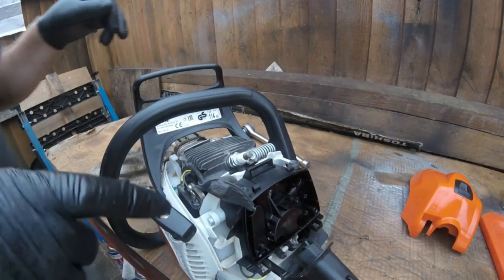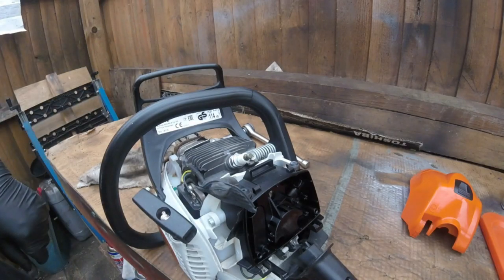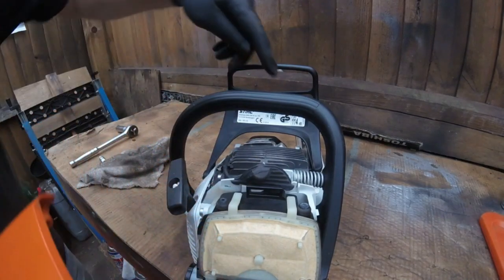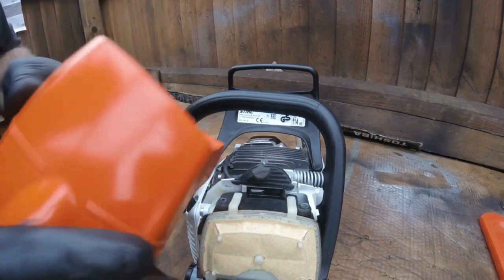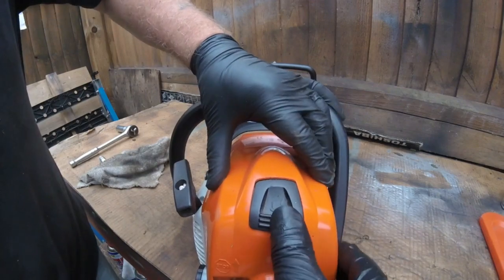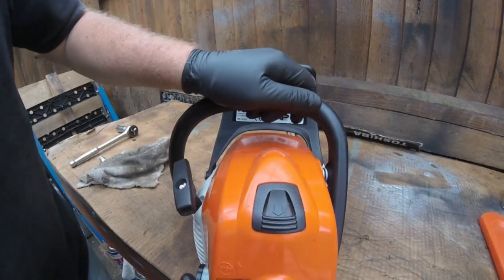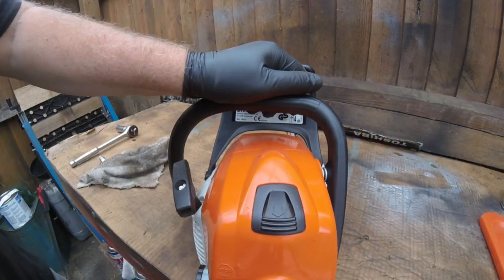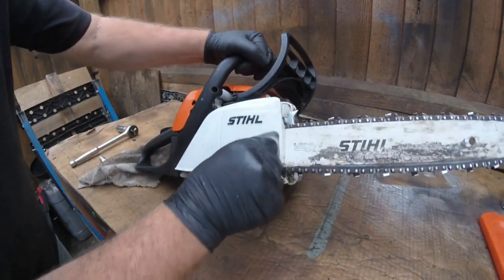So we're tying that up, put that back together, and then cleaning round by the chain area. That's all bolted in, the air filter's back on. Now to put these covers on - just inside there you've got two little lugs, they just slide onto there. Push in and then push that in - just give it a little testing because as you noticed outside it did come undone when I was running the engine.